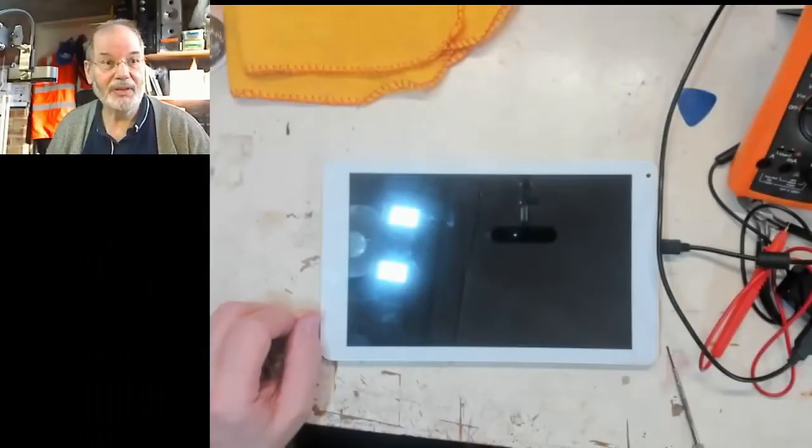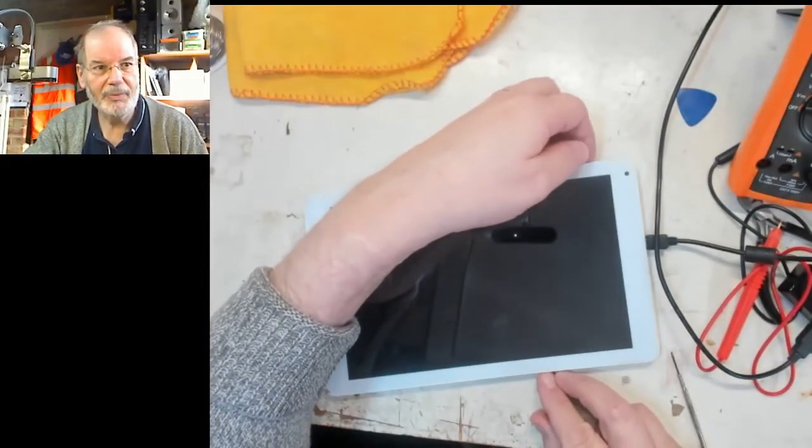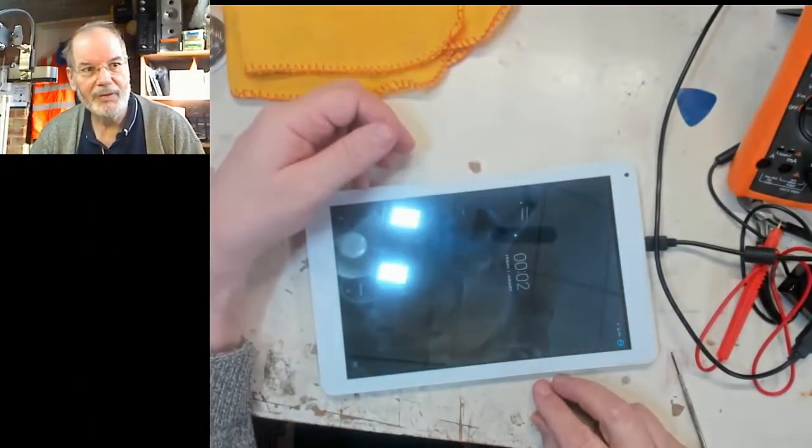Well, I'm really quite pleased with that. Being able to diagnose a faulty ribbon cable on the power switch, and identifying where the pin connections go to. Simple, you know, the switches really are just literally contacts. There's no technology involved in that ribbon cable. It's just purely a pair of contacts. And as we can see now, it's actually booted up. The display's just disappeared. Let me just quickly power it back on, see if, there we are.